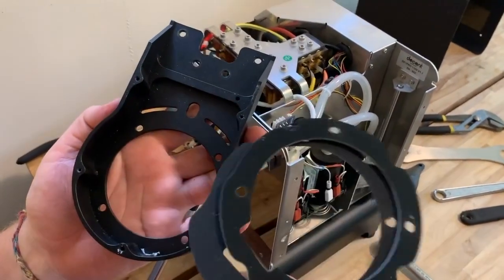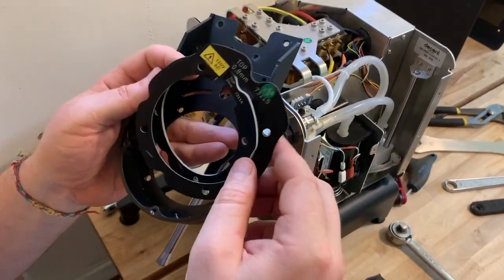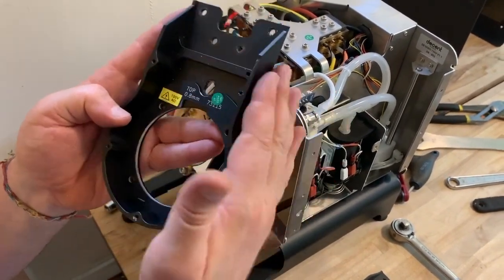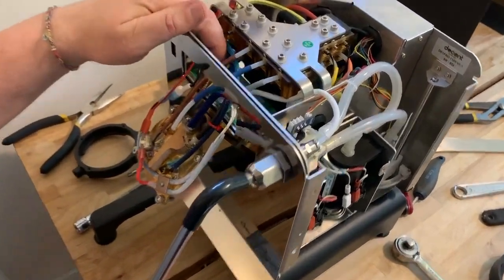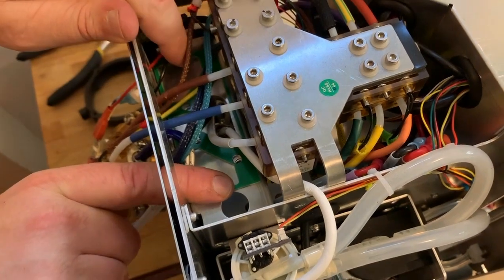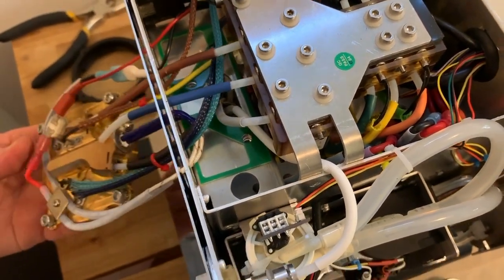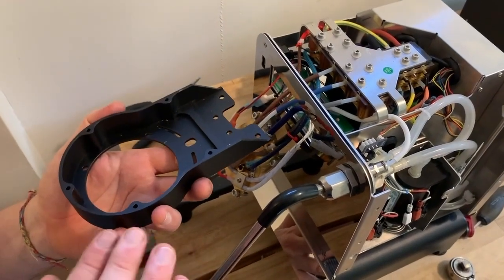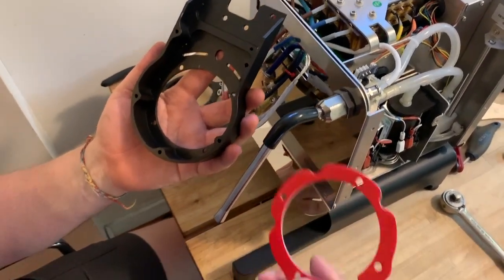In the old support you'll see two spacers — the longer one with a lip that comes over the top sits on top, and the more round one is underneath. The WPI sits right on top of those. The water path isolator isolates heat from the carriage of the machine so everything is cool to the touch. There's also another PCB isolator up here that isolates heat from the chassis. Make sure you position it well because there are holes in it for the bolts and you'll need to be properly lined up — you'll probably bump it a bit when you put the new through-bolted support in.